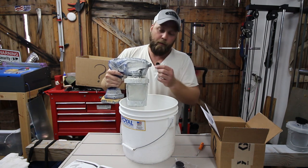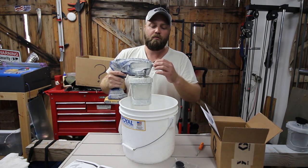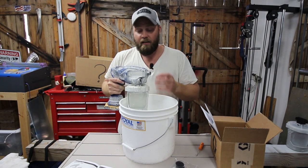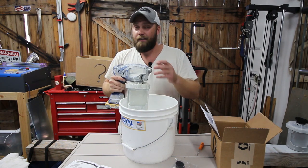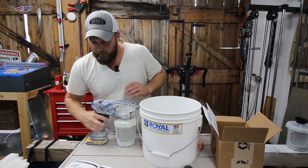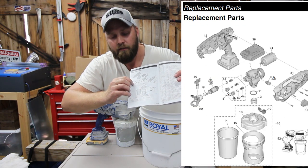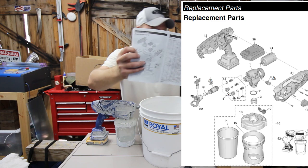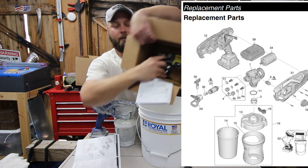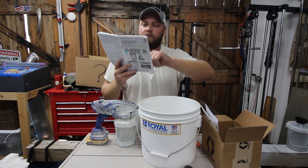I wound up using a little pick to depress the ball valve that's in there. I assume the pump is too weak to overcome the spring pressure of the valve, or it could be that the valve is so clogged and there's not actually anything wrong with the pump. Let me show you what those parts look like. That little one right there — number 36 and 25 — is the assembly and the ball valve that sits in it. And that is the front part of the new pump, which looks like that whole thing is number one.